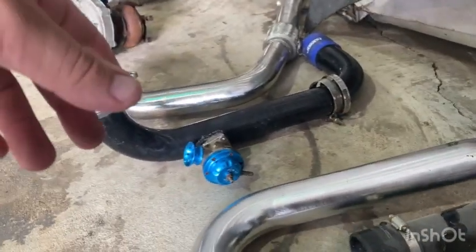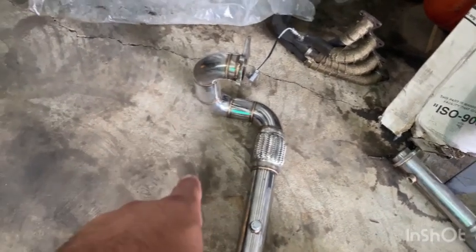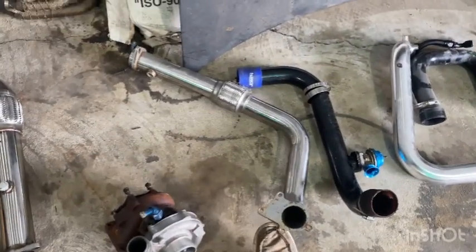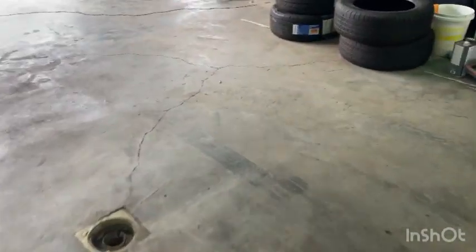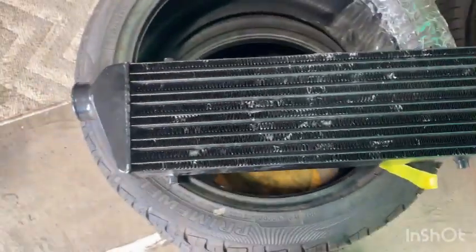The turbo was rotated the other way on the other car. Easton wanted to use this down pipe that dumps on the driver's side, but it won't clear, so we're using this other down pipe. We also have an up pipe. This is the other turbo kit off the hatch — there's the log manifold, the up pipe, and the intercooler they had on it. My brother Jordan just picked up a nearly brand-new intercooler for 20 bucks — we'll probably end up putting that on his car.